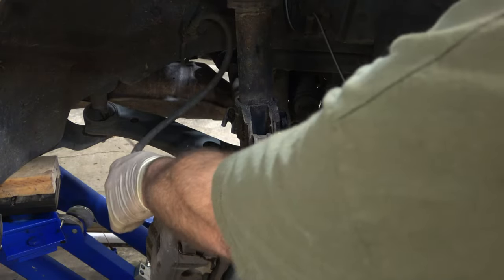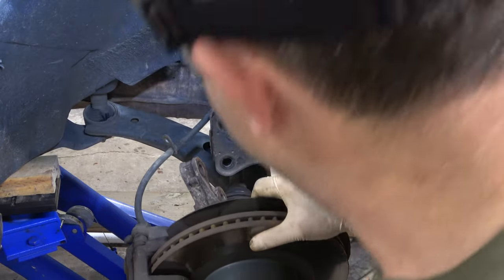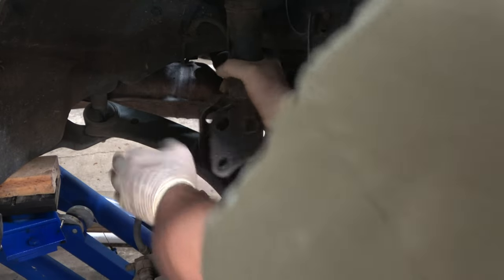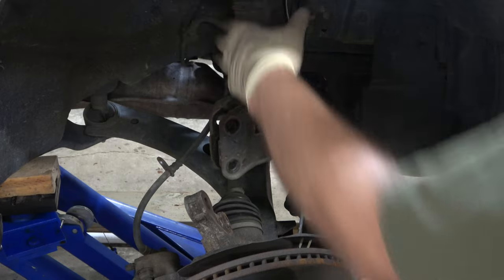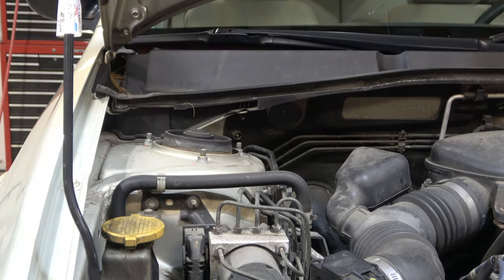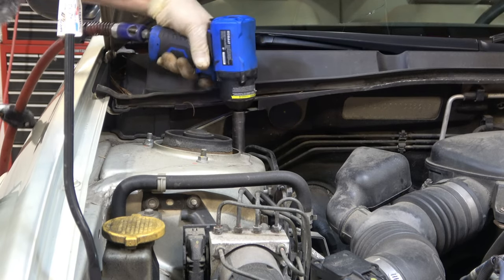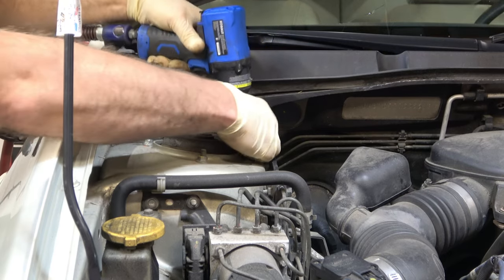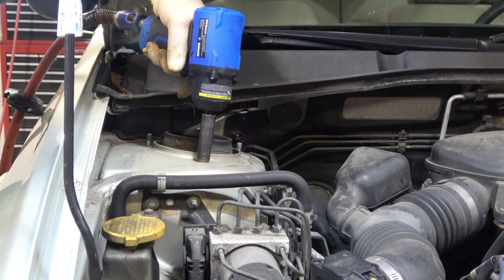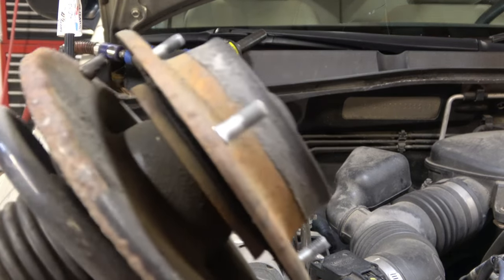With our sway bar free, our lines free, and our CV axle pulled back, we just wiggle until it pops loose. Make sure that our axle is out far enough that it won't get in the way. When I lower this thing down, I'll be sliding it out this side. I can pull down on this enough to get it around. You're going to want to have one hand on this and another hand up top. There are three 12mm bolts at the strut mount. I'm going to hold the strut cartridge from below and use a gun to undo these three. She's free — let's go over to the bench and install the lift.